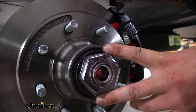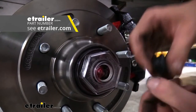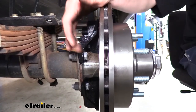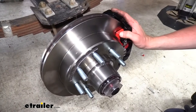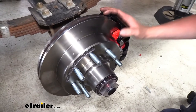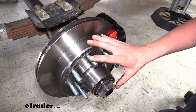We've got various kits available here at eTrailer.com, so you can get the appropriate bearing that's going to match your new rotor as well as the spindle on your axle. The caliper mounting brackets are designed to work with your existing flange, so you can reuse your hardware when you take your old drum brake system off. The brake pads that come included are going to be ceramic, which helps increase the life of the pad. The rotors come with the races for the bearings pre-installed, so you don't have to worry about driving in any races — that's done for you.